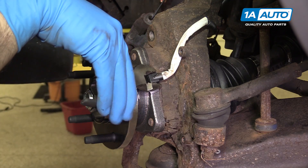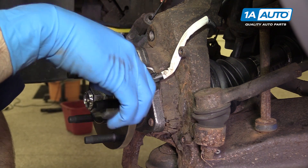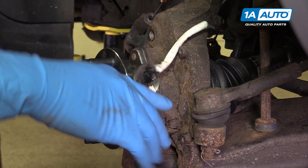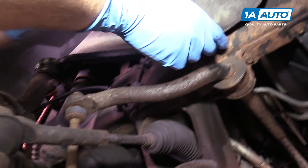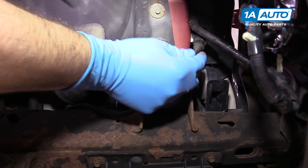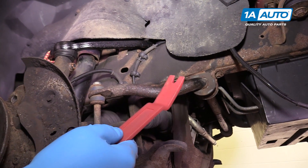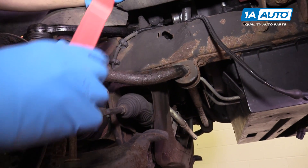Our sensor is brand new, so it's actually going to look a little easier than it usually is. You can just grab these with a pair of pliers and work them back and forth, in and out. Go easy with them because you don't want to break the sensor off in there. Follow the ABS sensor wire — right up here behind the front bumper is our connector. Simply push down and disconnect it.